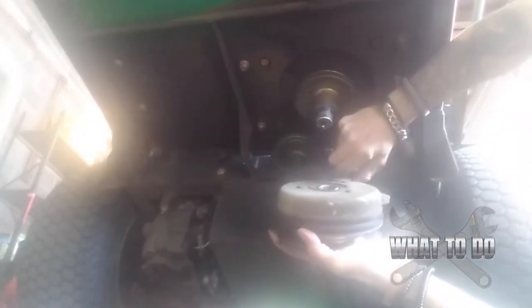With the deck out of the way, we're going to go ahead and remove the clutch. We're going to come under the machine here. Here is your clutch. Underneath you're going to see your 5/8 inch bolt. Our bolt is out — there's our clutch right there. Just make sure you keep a hand on it because it will drop. And you do have a wire here in the back, so unplug that wire first, actually, before you take that nut out. We have this belt still on here.